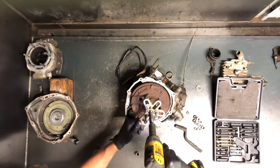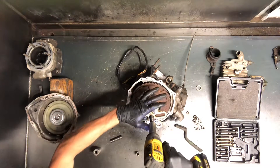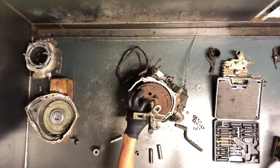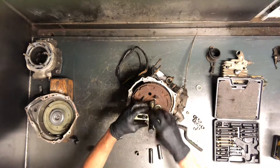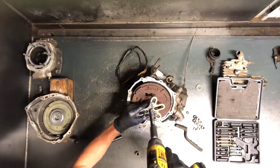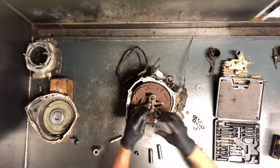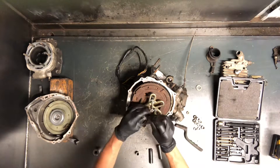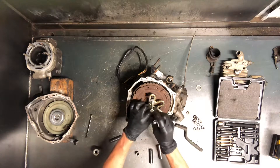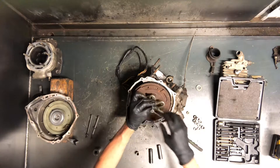Alright, then you spin this down. Just remember you've got that nut on there, so it'll just pop off. Once it pops off, then it's free, and you can take everything apart — it'll just slide right off of there. It's a tapered crankshaft and that flywheel is tapered as well, and that's what keeps it on there. There's also a keeper.